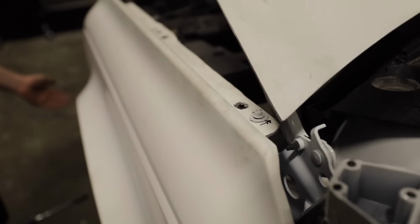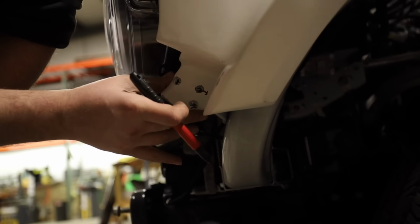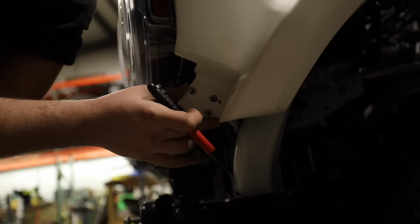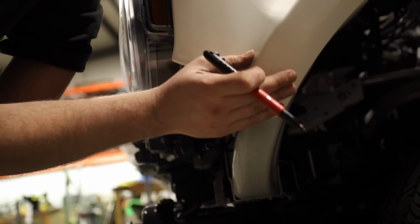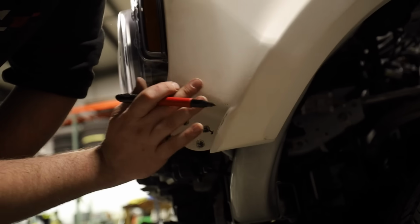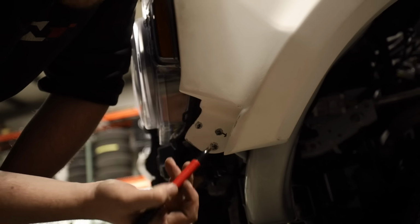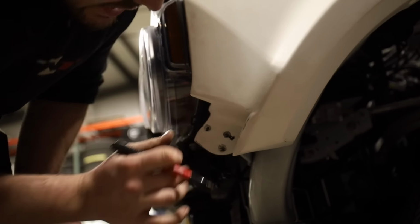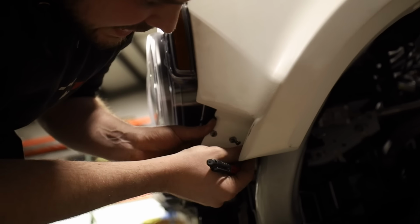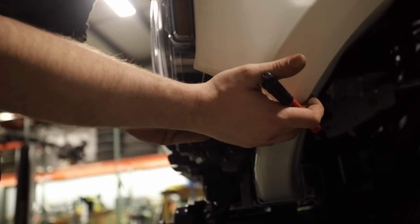And then down here as well, on this piece, I noticed that I could hit the hole, I could get in there, but it's putting a lot of stress on this piece here, which looks like they already did some body work and molding in here before. So I don't wanna stress this anymore. So we're gonna pull this hole down a little bit this way, and that'll give us the adjustment we need to bolt this in and not really tweak this fiberglass.